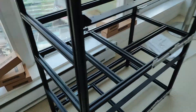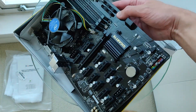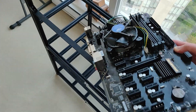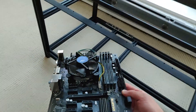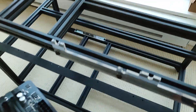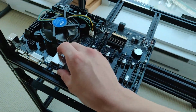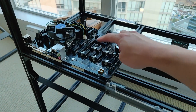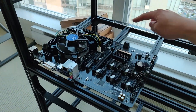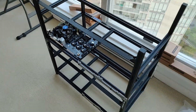Let's go ahead and put the motherboard in. There's the Gigabyte B250 motherboard. Let me know if you think I should put this on the top or on the bottom. Depending on how long my risers are, I have a feeling I'm going to put it right here in the middle, because the risers will go up to the six GPUs on top and another six will go down to the bottom six cards.